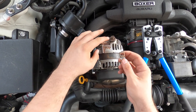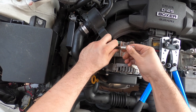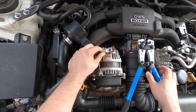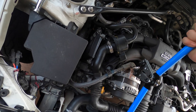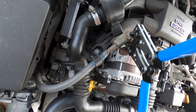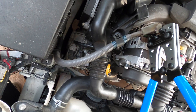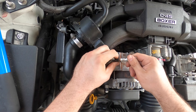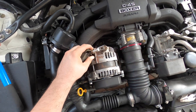You can get these at auto parts stores — in my case I got this one at Home Depot. Make sure to get the right size for your car. To use the crimper tool, just twist the little black dial until it shows the right gauge size, then squeeze it down right over the connector and it crimps it shut. Make sure that connector is tight — pull on it; it ain't going nowhere.